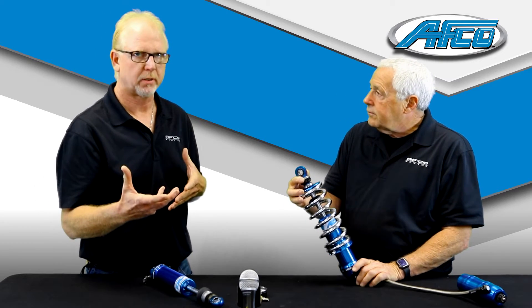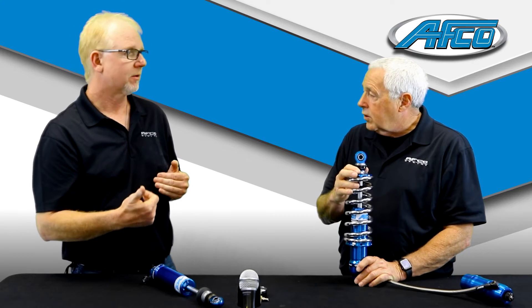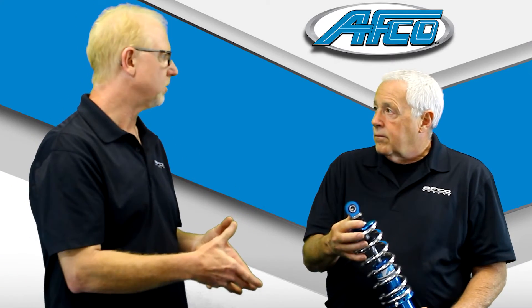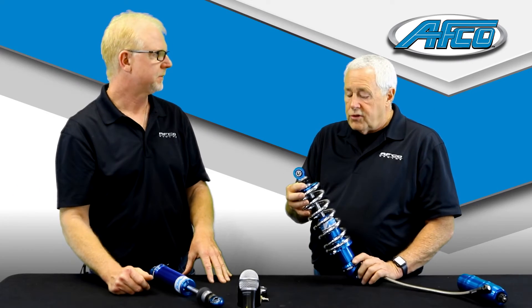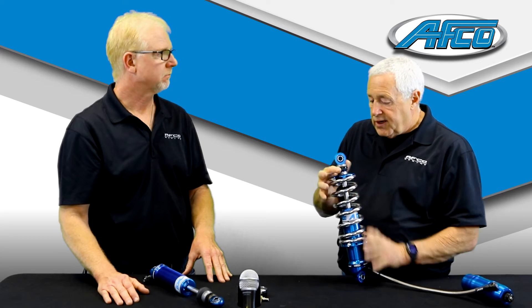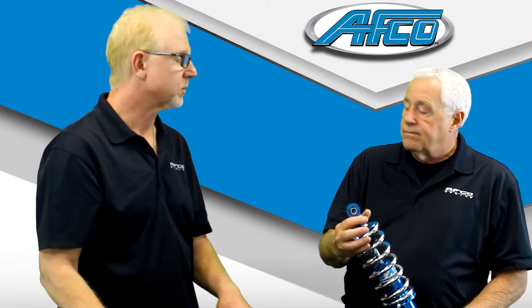So if you're thinking about putting a 100-pound spring on your car with the shock straight up and down, but you've got it laid over 30 degrees, you're going to have to put a 125-pound spring on that application so that the car feels like it's got 100. You have to go up in spring rate when you lean the thing over. So if your chassis tuner recommends a 100-pound spring, but in your application it's laid in 30 degrees, you need a 125-pound spring.